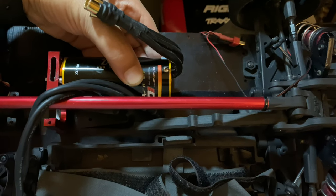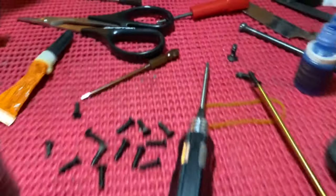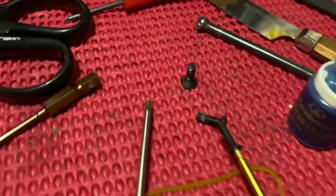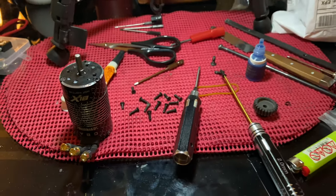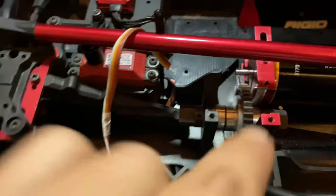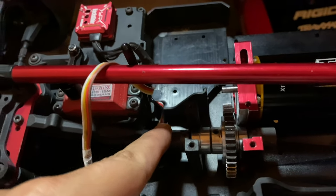You can put a 4070 easily. Note that 2.5 millimeter screws will not fit the TB motor — you need 2.0 millimeter. I found screws the same length as the old ones and I'm fitting them right now. The BLX motor holes are 2.5mm but the TB motor holes are 2.0mm. Pull it to the original central depth and always make sure your spool is spinning freely.